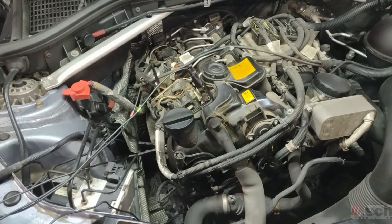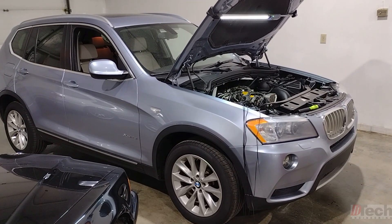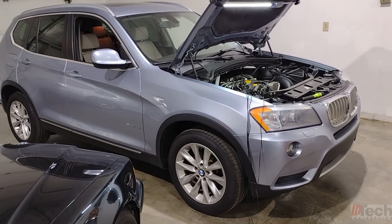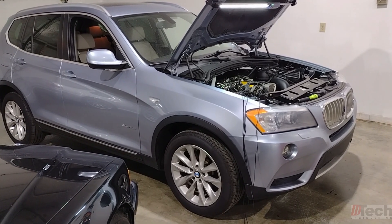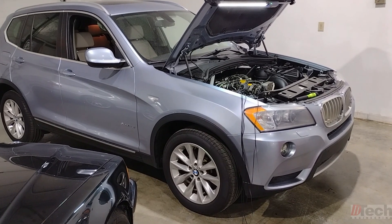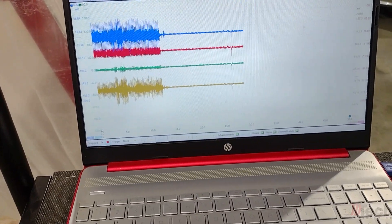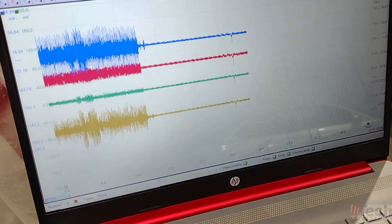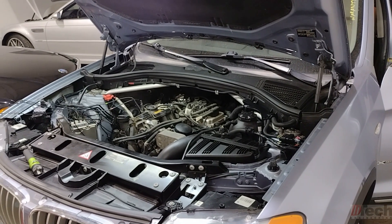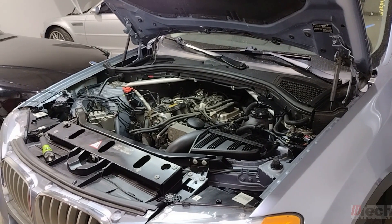The noise, if they want to rectify it, will need lifter replacement. I hope you enjoyed that demonstration and understood it. You can identify multiple noises at one time and clearly see which one is the culprit — we can audibly hear it and simultaneously see the rise in amplitude and frequency in certain areas compared to others that don't change. Using the scope this way lets you identify the issue 100% and avoid any wrong calls. Thank you for watching.